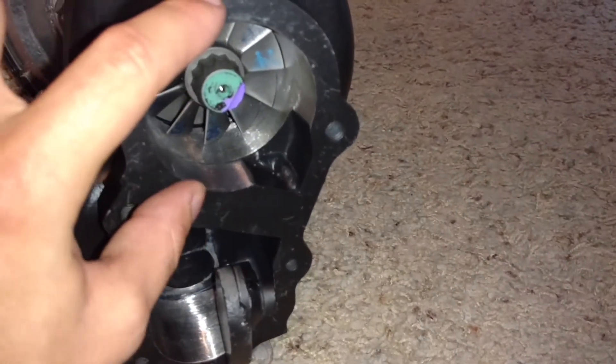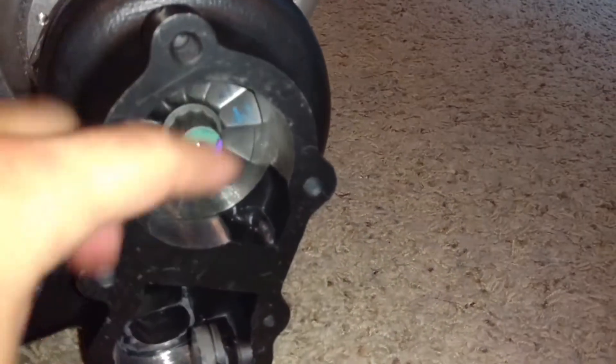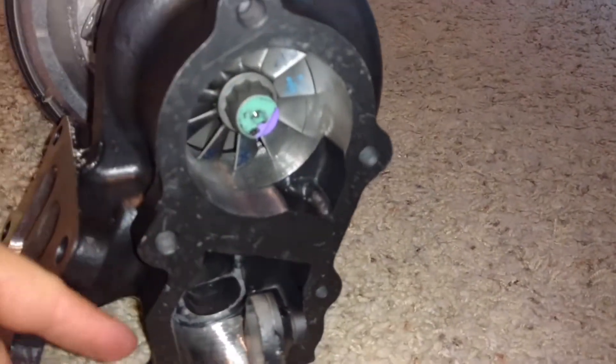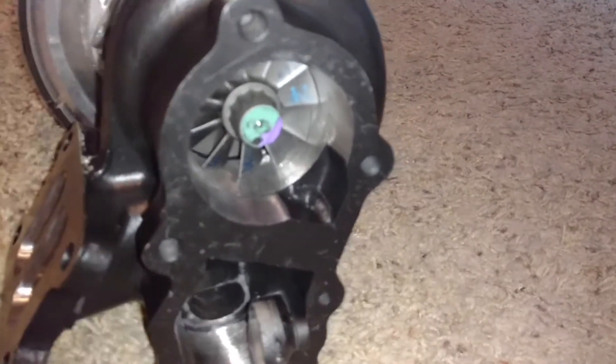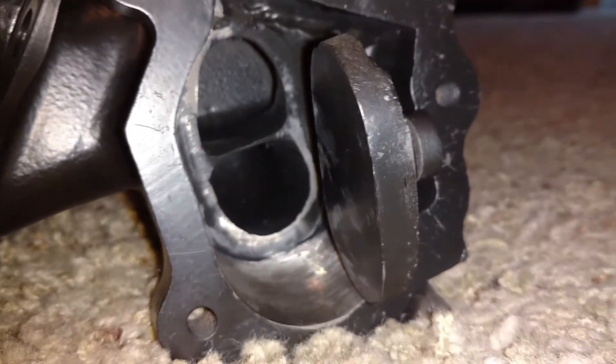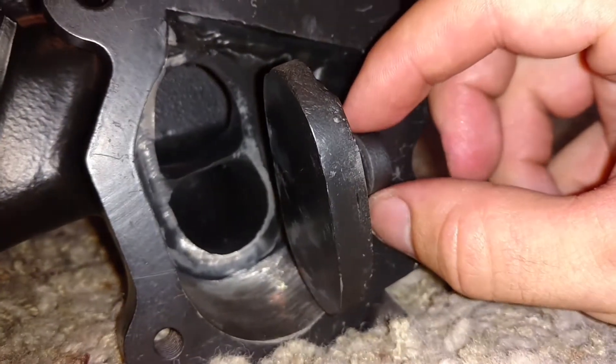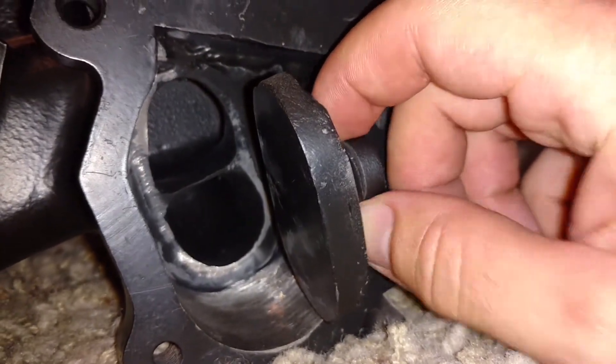So 74 millimeter — that's essentially a three inch going to be coming out here, and have this flange put back on because it's missing, but I'll get it back. Into my huge D-port shape turbine exit. This is a wastegate exit.